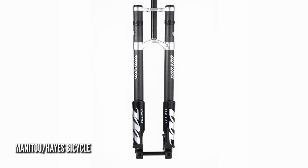37mm stanchions on there. So it was 36mm previously, and they've upped it to 37, but they haven't jumped to like 38 or even 40 because they say they haven't needed to. They found the optimum combo of strength, rigidity, that torsional flex. You do need an element of flex. If you get the fork really stiff fore and aft and it has a tiny bit of flex, actually you get traction from that, you get compliance. They're all good things. So yeah, it's got plenty of that.